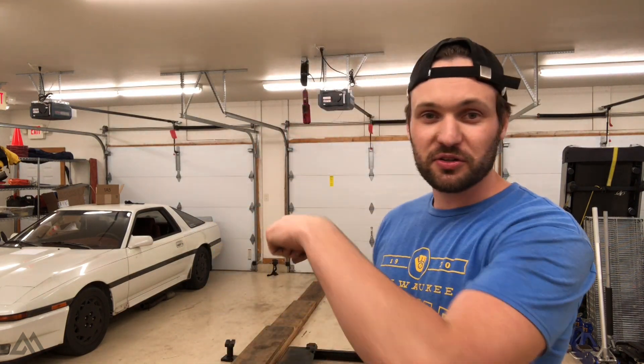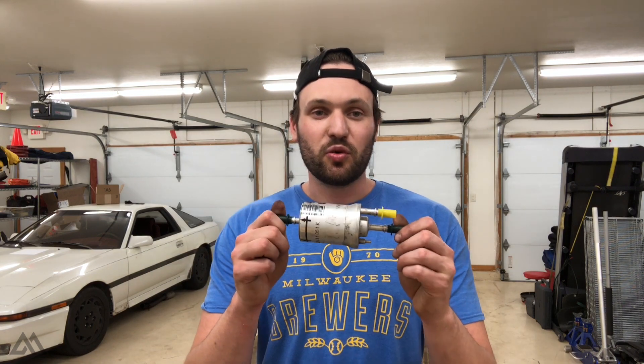I know that was a rough one — didn't have a very good angle on the camera due to this scissor lift; the arm was kind of right underneath the fuel filter. I want to link another video in the description — it's going to be Deutsch Auto Parts and they're going to do the identical install, except on a GTI instead of a Mark VI Golf R. Exact same procedure, much better video quality. Quick recap: remove the three fuel lines, remove the screw holding the housing in, remove the old fuel filter, install the new one, prime the pump, and start the engine.